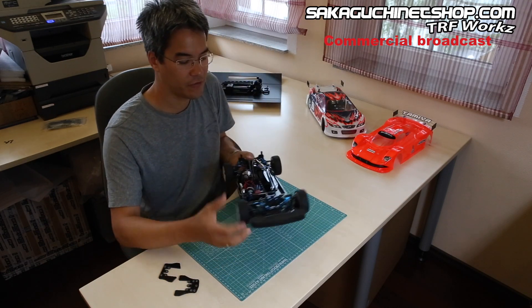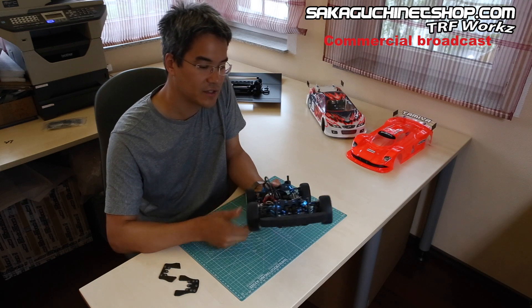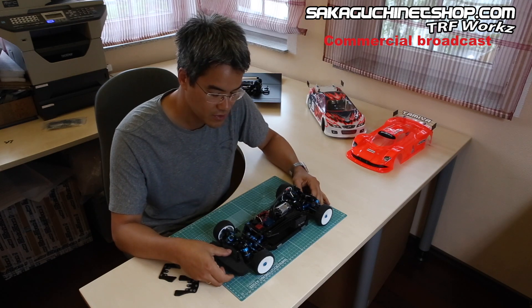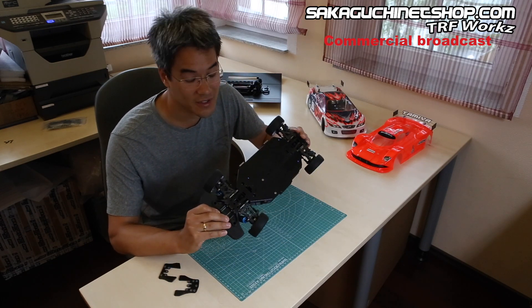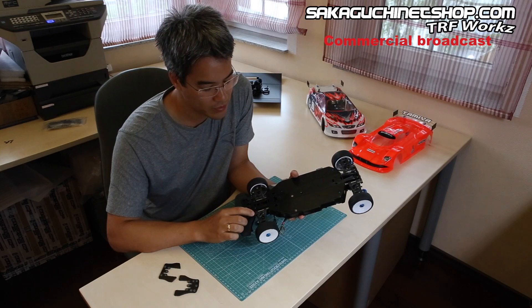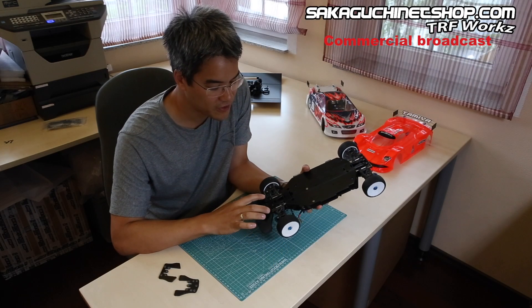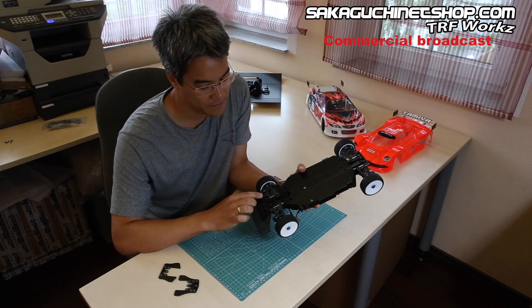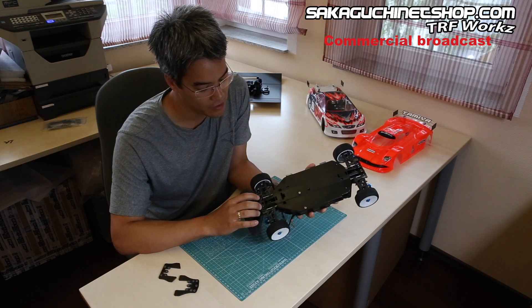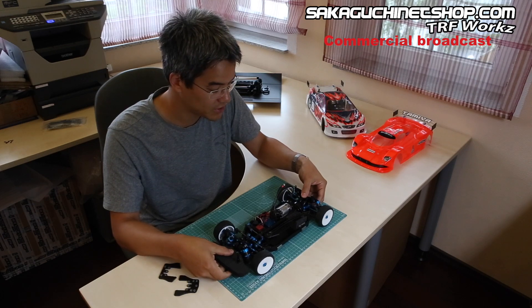The front spool is already in the kit of the SR. The rear oil-filled diff is already in the set, so the car already comes pretty nicely equipped. The reversible suspension is also on the car. I've added droop plates here on front and rear. To fit them on the front you need the front steel suspension block, which is available optionally. This lets you set the droop settings for front and rear, which is quite important for a proper racetrack setup.